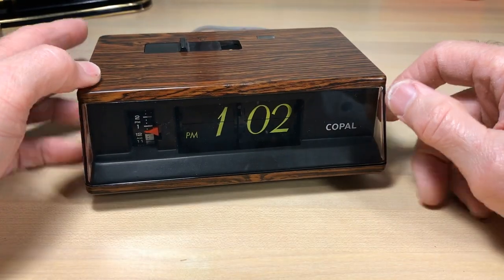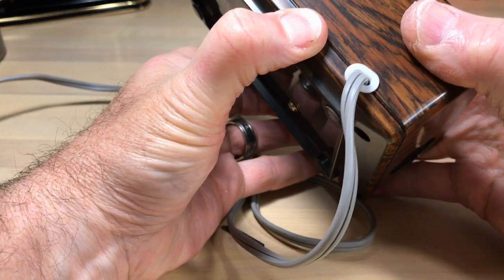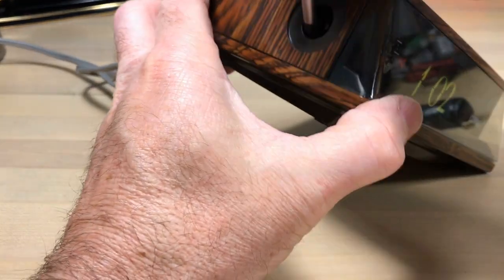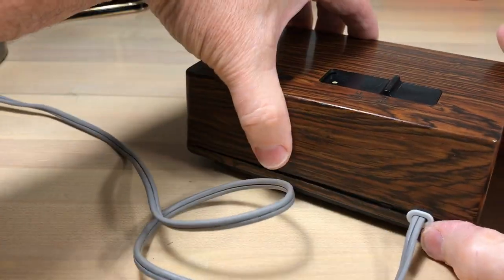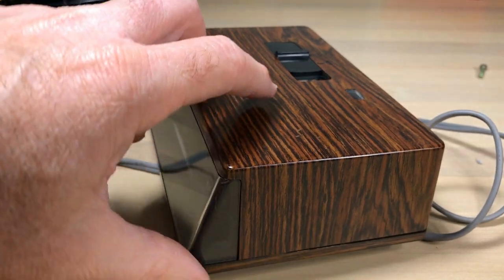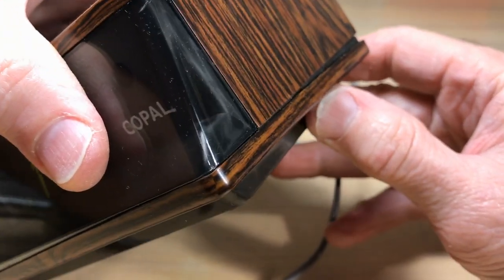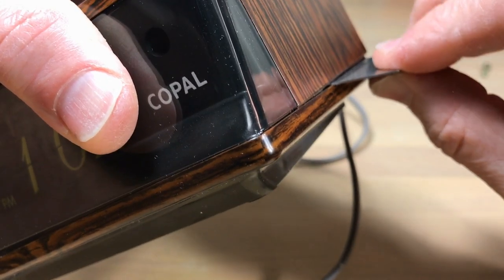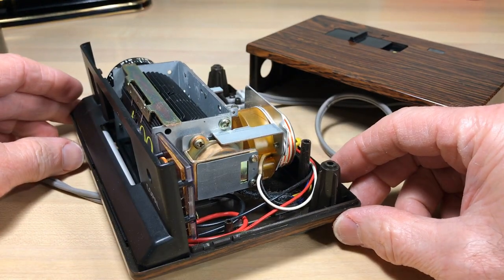Let's say we've taken the knobs off - how do we get it apart? We don't need to bother with the button on top. There are tabs in the back - two in the back and one on each side - and they're interlocking. The only thing that's going to give is the cabinet itself. I'll give a little pressure with the screwdriver without marring the case - it almost takes the back off by itself as I work it around. This side is the problem child, the one that holds back. I'm taking a razor blade to get it as close to that tab as possible, then prying up - it doesn't mar the case.